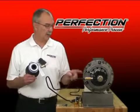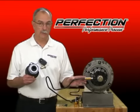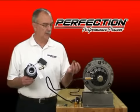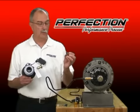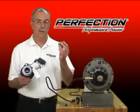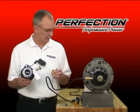Today I'm going to demonstrate the correct technique to disconnect this line from this slave cylinder. If you use a special service tool that we provide with the kits, generally speaking, it'll snap out pretty easily. But if that line has been exposed to lots of road salt, road grime, or has been incorrectly serviced over the years, it can be virtually impossible to get the line to separate from the connector. That requires the additional expense of a new line, downtime while you're waiting for the parts.